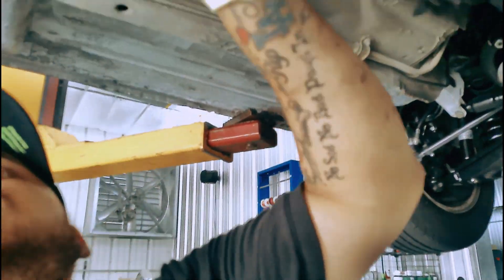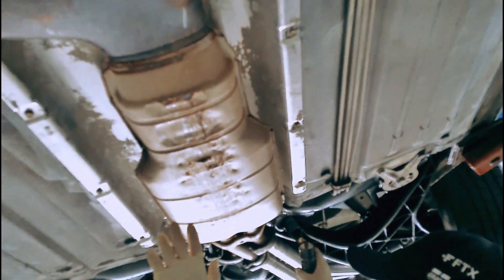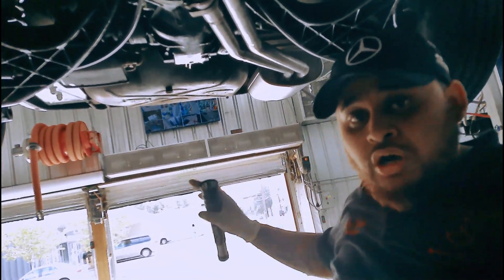You've got what's called a half shaft — take off this shield here and take the driveshaft off the half shaft. Once you've got that off and everything is supported, you can bring the whole rear subframe down and it'll all come down as a full assembly.